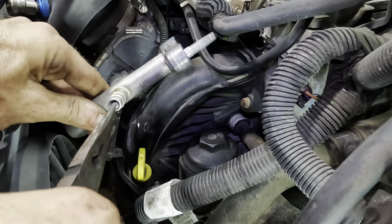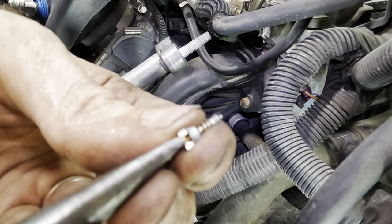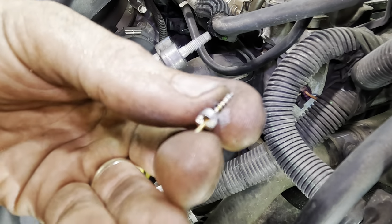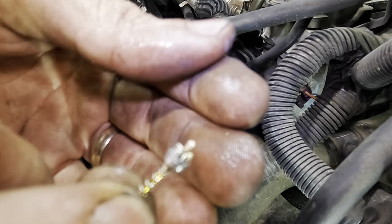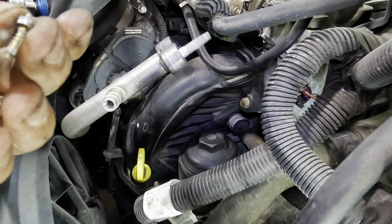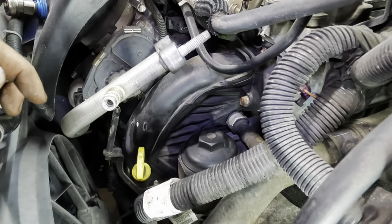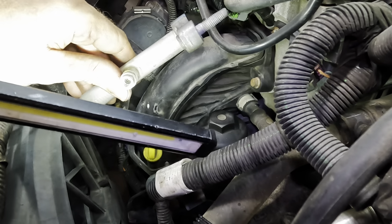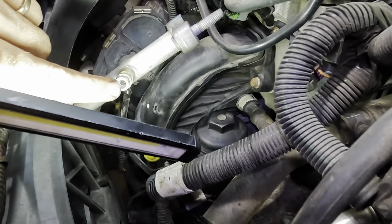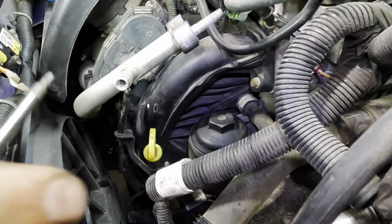Come on, you. Oh. Yeah, I got half of it. That is half of a valve. Okay. Yeah, look. There's some of the threads right there. This is never seize. There's anti-seize on this. Yeah, somebody knew they boogered this up. What's the deal with that? Let's see if I can see down inside of that hole right there. Yeah, that's a negative. I see the other end of this, the Schrader down at the bottom. I gotta try to dig that out next.